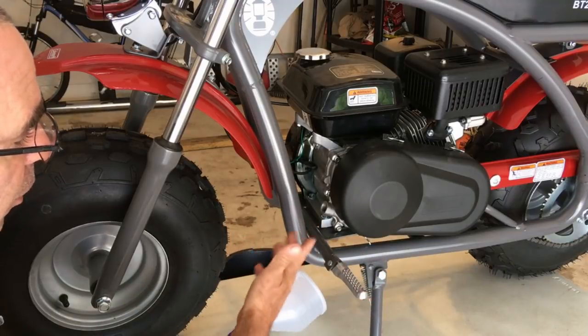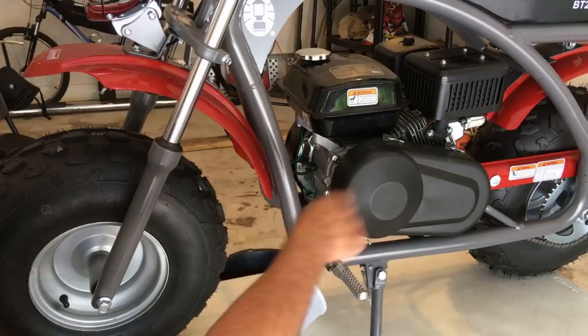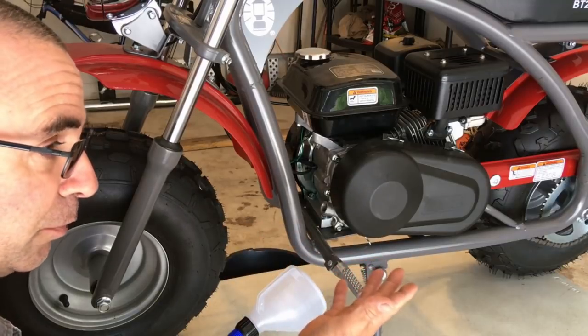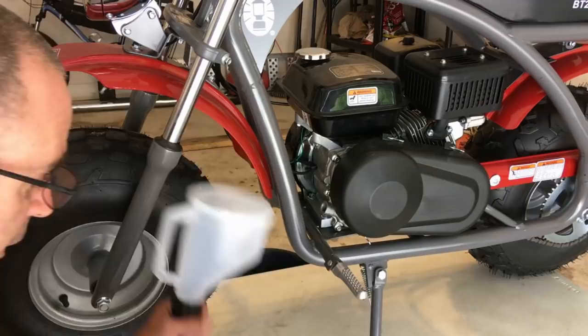If you are low on oil, that spoon or splasher or whatever you want to call it isn't splashing into the oil far enough down, and so you're getting thin oil coverage in your engine and your moving parts aren't getting lubricated properly. That's why you want to make sure you definitely have proper engine oil level.